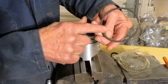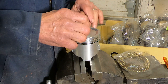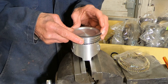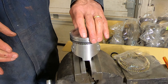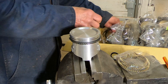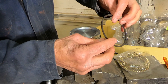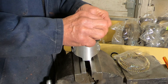If there are any markings on the rings, like this one has a little dot right there, that means that side goes up. So I'm going to put it on and rotate it around. I'll rotate that one around this way. Then for the top groove, it's a similar type of thing, but there are no markings on this top ring anywhere — the edges are square inside. If there was a bevel or a chamfer on one side, that might indicate a direction, but since this one is exactly the same all the way around with no markings, it can go either way — upside down or right side up, it doesn't know the difference.